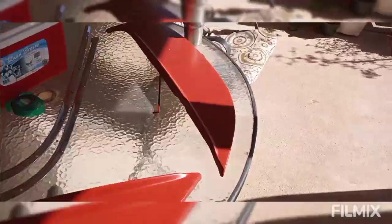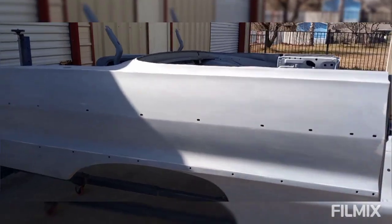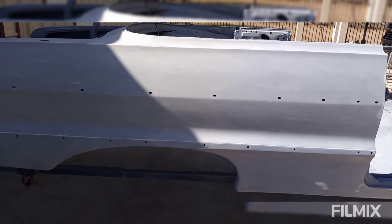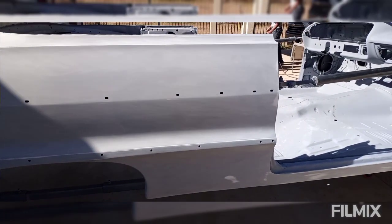He's got the skirts — I don't think the skirts really need a whole lot of body work actually. So we're going to get this thing in two more coats of the SPI 2K high build, and then we're going to move up to 320 grit after this, maybe 220. We'll bring you guys back once we start mixing some paint.